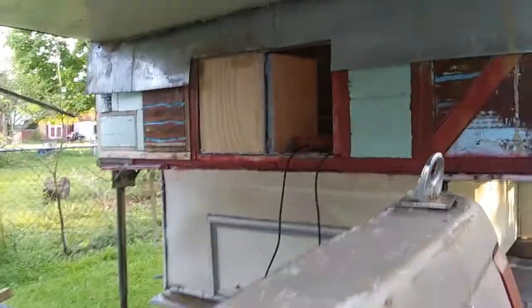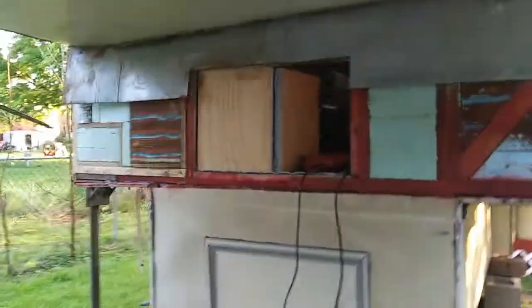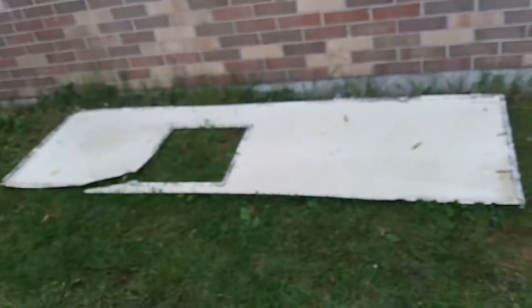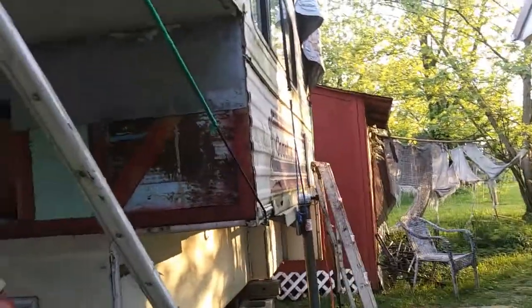I painted that wall and I have all my insulation in my front panel. I filled up my little access service door — I'm not going to access that unless I absolutely have to. The next step is to clean this and put it back on, tack it into place first, then use some silicone to put the moldings back on. I don't have any butyl tape right now but I'm going to seal it up this way and get it done. I need to fix this front piece — it isn't exactly on right.